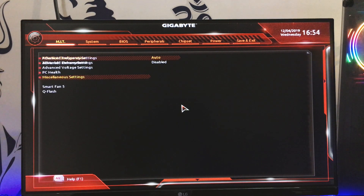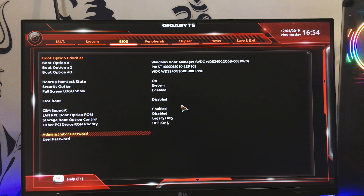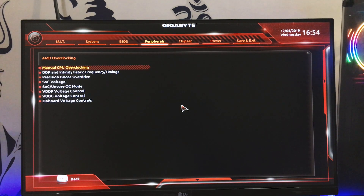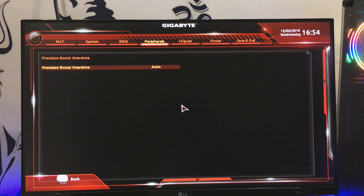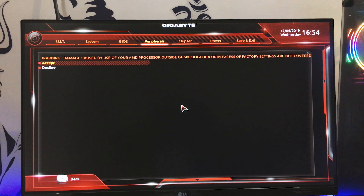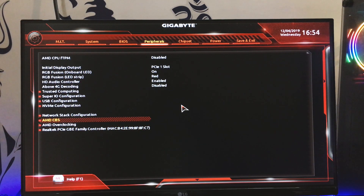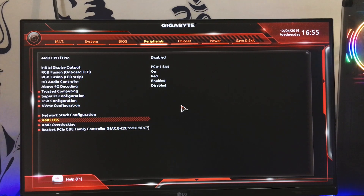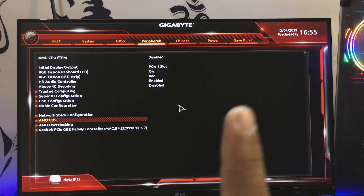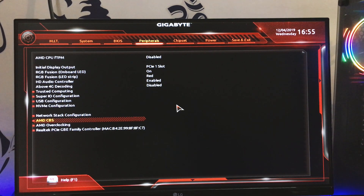In the Advanced Frequency Settings you can enable overclocking. When you accept the AMD overclocking prompt, you get access to manual OC and DDR settings. Precision Boost Overdrive must also be enabled from here before it will work in the operating system. However, if you are not using an AIO or custom liquid cooling, I'd advise against enabling Precision Boost Overdrive — AMD is known for running hot, and with my system already at 66 degrees, temperatures could easily hit 90–95°C with PBO enabled on the Ryzen 3500 series.